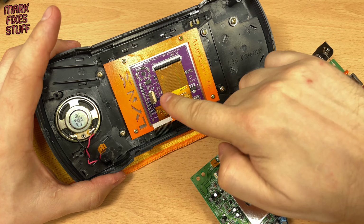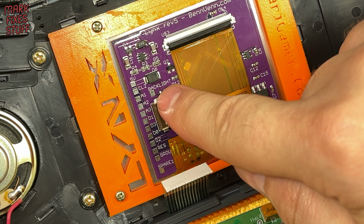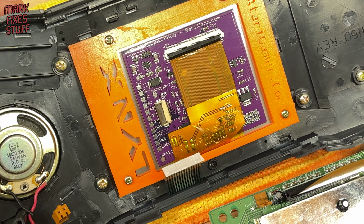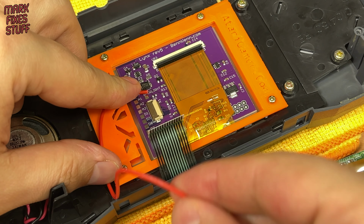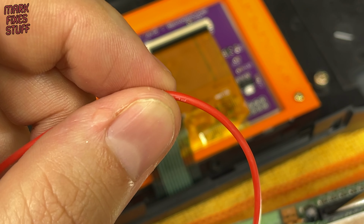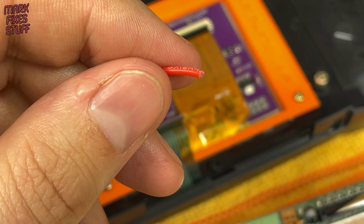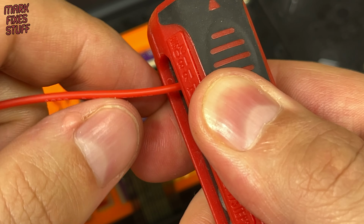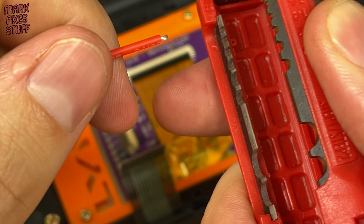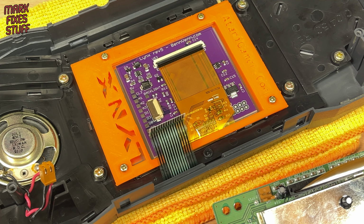There is one piece of optional soldering. A single wire from the backlight pad to the main board to enable the optional button control. Of course, you know I can't resist doing it, but you don't have to. Attaching this wire will allow the brightness to be controlled in step. Holding the button will also toggle the optional scan lines. Brightness is still controllable using the contrast wheel, even without the wire.